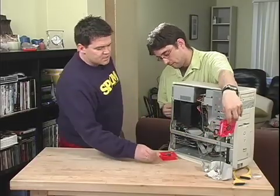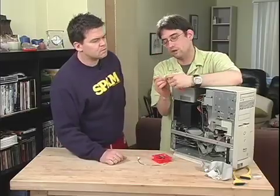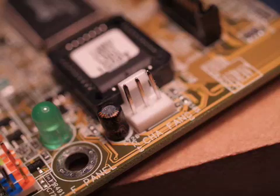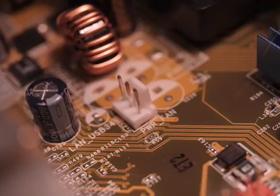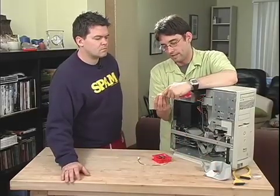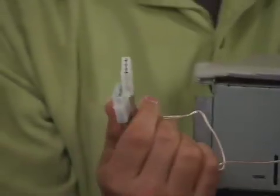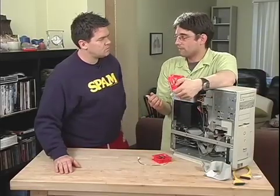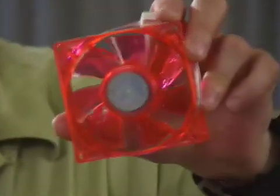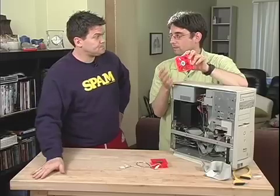What you want is to orient the fans — generally by the label side — so they're both going in the same direction. It'll pull air in on one side and push it out the other, pulling it across the components and out through the back. These little dongles are designed to attach to the motherboard — if you've got a newer motherboard, you may see a little three-pin connector that this will connect to. Often when you get the fans, there will be a little adapter that lets it attach directly to your regular Molex power connectors. Some fans come with that directly. You want to make sure you get one with the proper connectors, either for the motherboard or for the regular power supply.